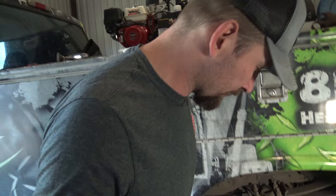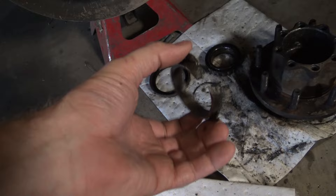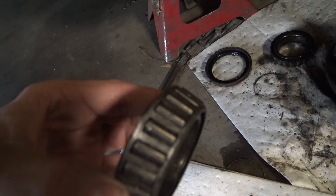All right, so we're finally back on the service truck. I got that nut off finally, and oh man, let me show you the aftermath — this is what I ended up having to do. I had to chew this thing out of there with a carbide bit. It used to look like that, and kind of gummed up the old wheel bearing. I forgot — I've got to go get a new wheel bearing. I thought I had everything.